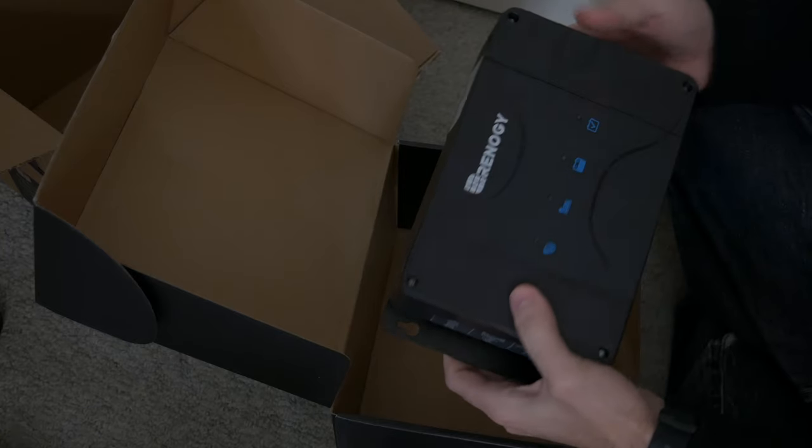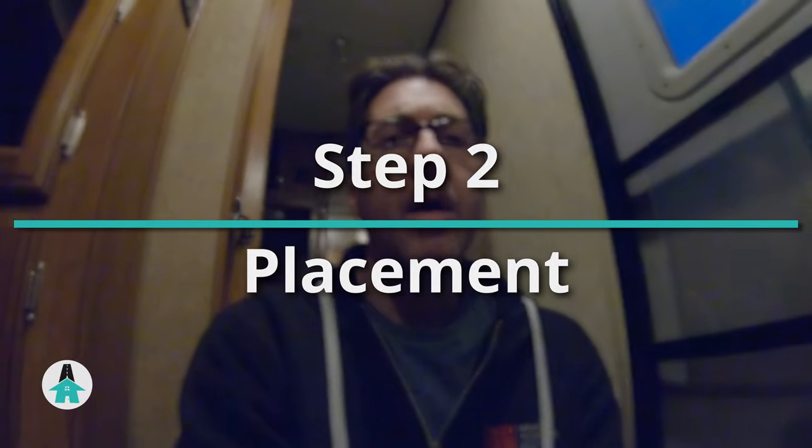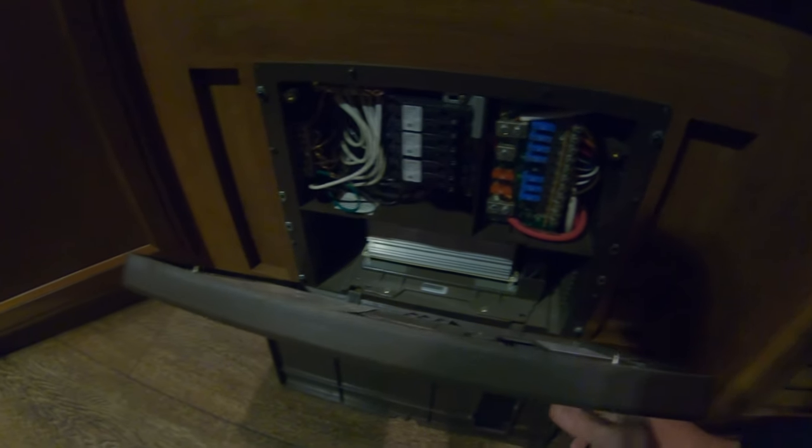Did you know that lithium batteries need above-freezing temperatures to charge? So it's best to put them in a heated area in your rig. You'll also need space for a charger and an inverter, so this begs the question: where do you put everything? The converter and electrical components are way in the back — not easy to access but with a fair bit of space. I'm thinking to install the charger and batteries as close to the main converter as possible to minimize current loss and wiring length.